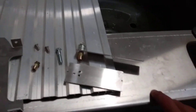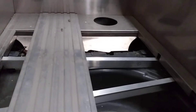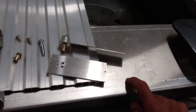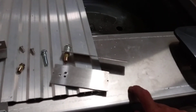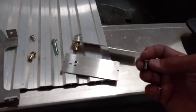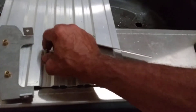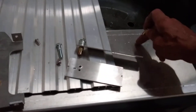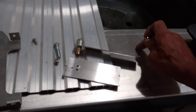But when you're mounting your bed floor onto the trays — front and back, there's the front tray up there and this is the back tray — this is only an eighth of an inch thick. For fasteners, if you were to thread the fasteners, after a few years they'd probably back out and get loose. So a lot of guys — we include these rivnuts in the kit — and we use them anytime we're fastening to the thinner eighth inch aluminum.